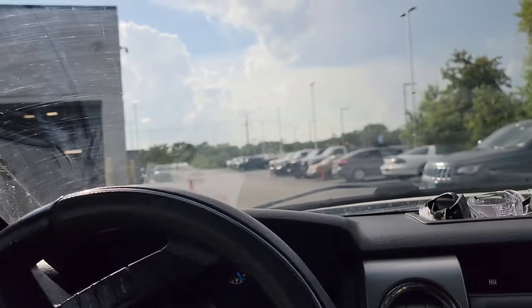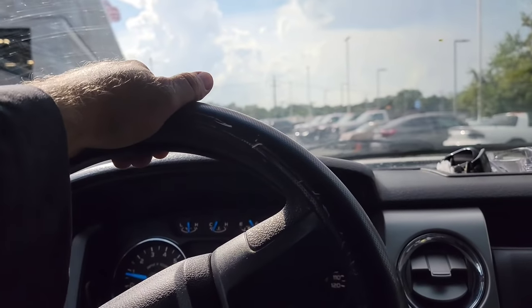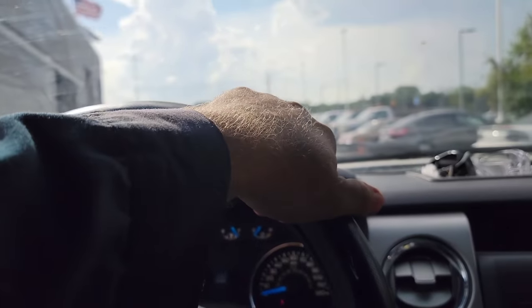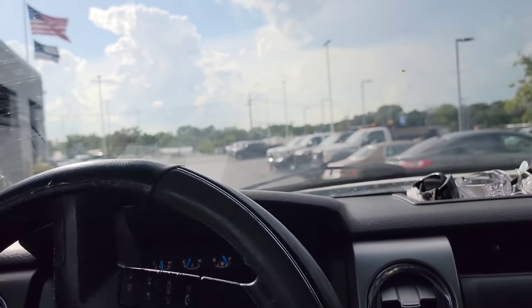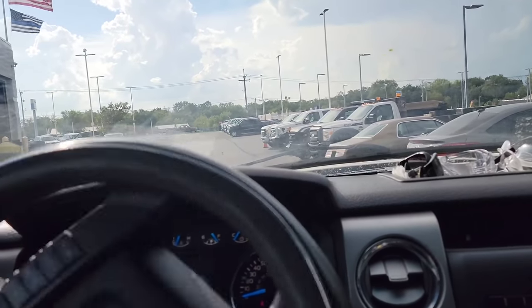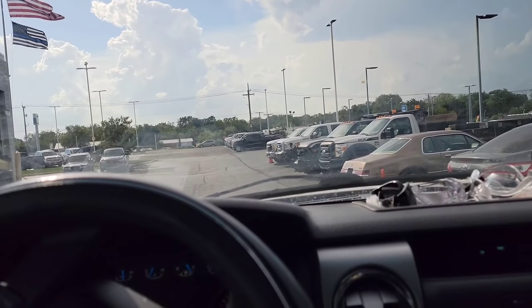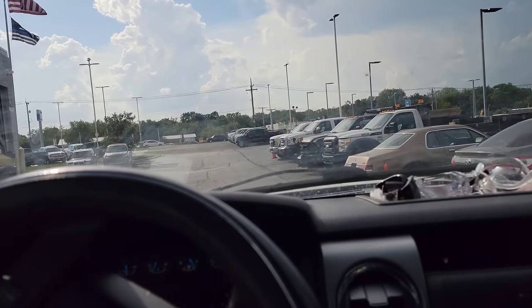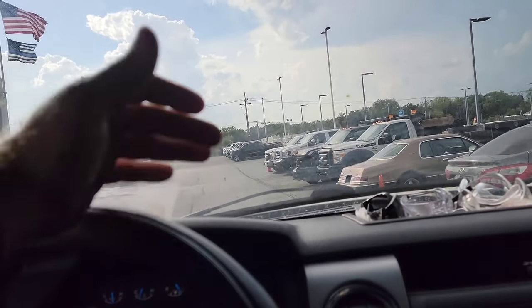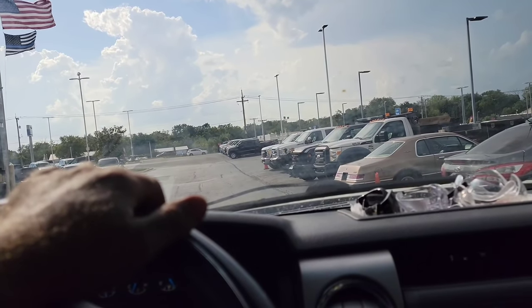Same situation. I just covered this not too long ago with a poor recommendation by Scotty Kilmer when he talked about somebody filling up gas, and he pointed at the charcoal canister. Even though it's part of the system, it's a very poor recommendation because it has nothing to do with the charcoal canister. The charcoal canister is specifically a storage type unit. Move all the way to the front of the engine where the purge valve is at, and that's typically what the problem is 99.9% of the time.